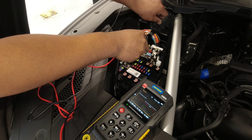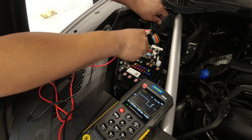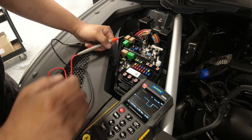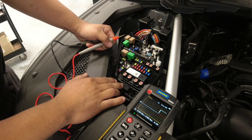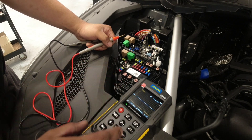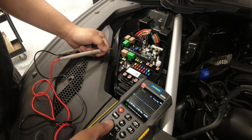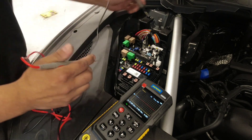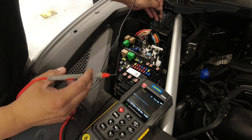It shows 12.6 volts right there — there's a number and we can see the lines on the scope. Now we're gonna try a communication line. There's a multipurpose check on this fuse box — there's a DeCAN, which I think is the diagnostic CAN, and also a CCP CAN. So we're gonna go to the diagnostic CAN and see how that shows. We can adjust our voltage first — we'll go down to two volts per division and connect my other lead to ground.